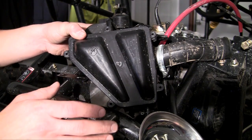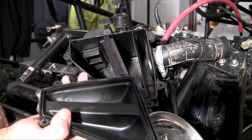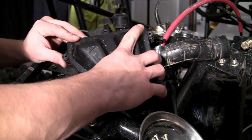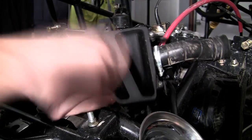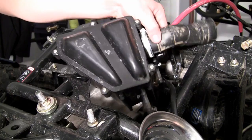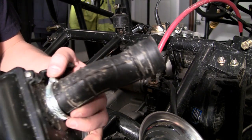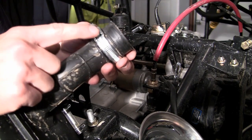The first thing I want to show you guys is the process of how you install the air filter. The first thing you need to do is make sure that your cover is installed. If you don't have a paper filter or whatever type of filter your air filter uses, go ahead and stick one in and then screw on your cover. Now, you want to take note of everywhere where you're going to have a hose connection — first of all, the obvious is the big main hose that goes to the carburetor.